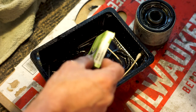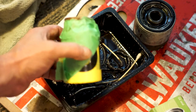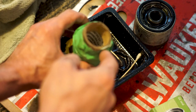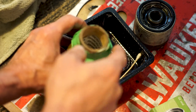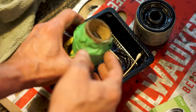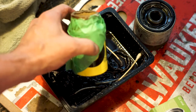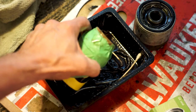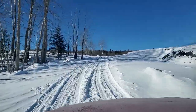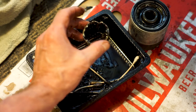That oil seal fit perfect, no problems. I've read you can use one-inch ABS tubing modified a bit, but what worked perfectly was a cardboard tube from a roll of tree marking material. It wasn't quite long enough to get over the sector shaft, so I added an extension, taped it up, gave it a few taps with wax, and it goes in about a quarter of an inch deep. That worked perfect.